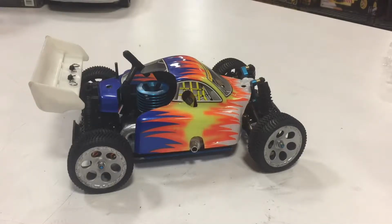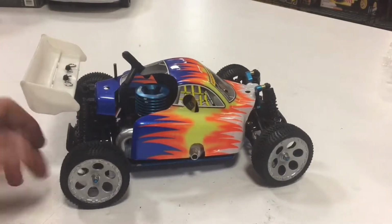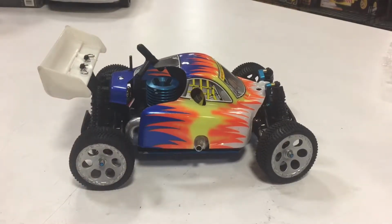Well, that was a pretty simple, straightforward replacement. The original bearing wasn't worn out too bad, really. I did put a shim in behind the clutch bell to space it away from the flywheel a little bit, to prevent more of that scraping. It doesn't ring nearly as much. It does roll quite a bit easier now. So something tells me that was the main culprit.